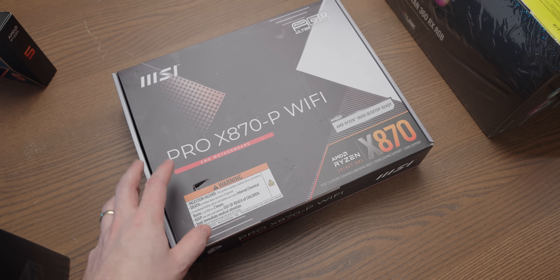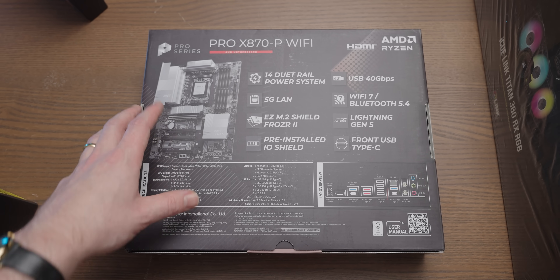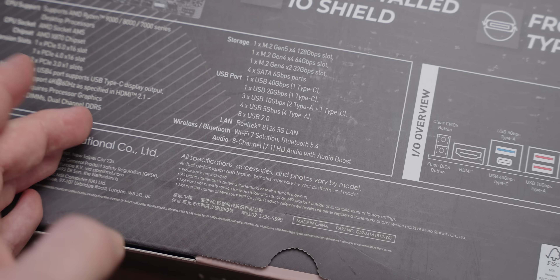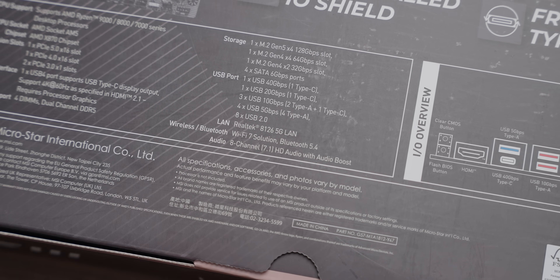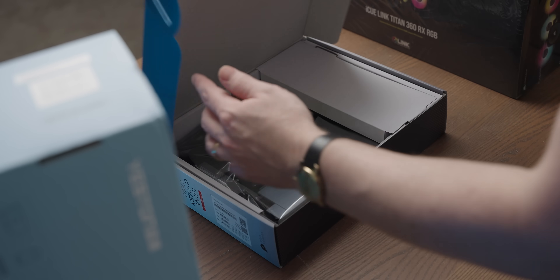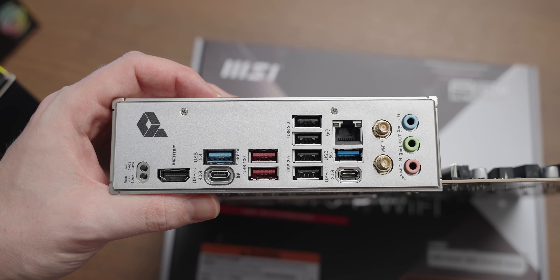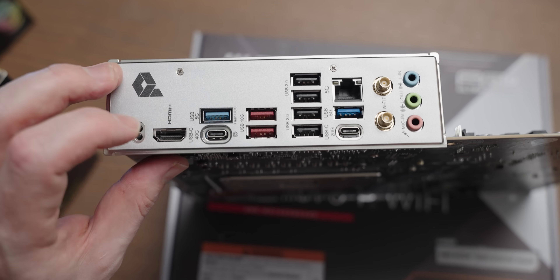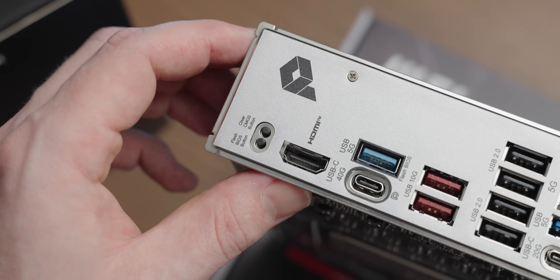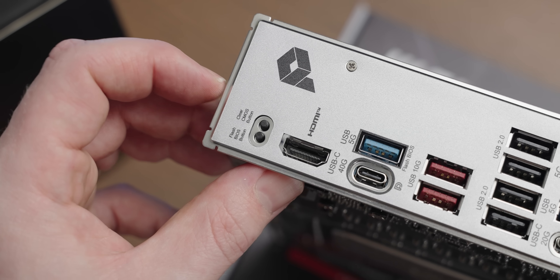For the motherboard, I got this MSI Pro X870P because it was the cheapest X870 board I could find, although I kind of like the silver aesthetic of the heatsinks. It's got a whole bunch of very fast modern connectivity, although I'm a little bit worried about this Realtek 5 gig LAN, because I've been wronged by non-Intel chipset networking before. There's a whole bunch of different USB speeds, including 40 gig, and we get a CMOS reset button right on the back plate — a really good spot so you don't have to dig around in the case.